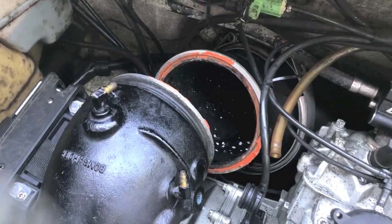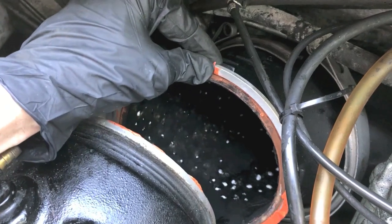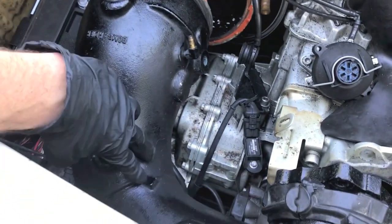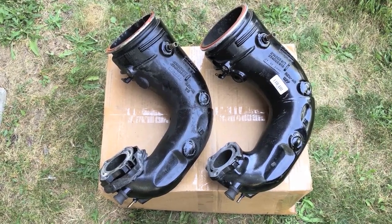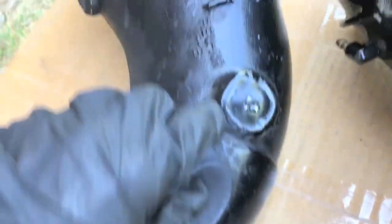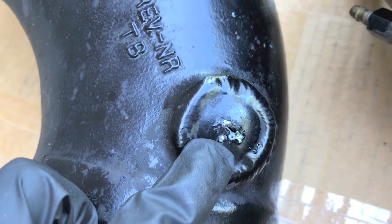The manifolds are now separated and you can see the old rubber gasket. Slowly peel this off and go ahead and remove this entire manifold off the engine. Here are the two manifolds — the one on the right is the brand new one and the one on the left is the old used one. Check that hole out — water is coming out of that hole fast and under great pressure, spraying all over the entire hull of the jet ski.